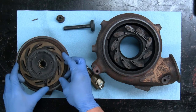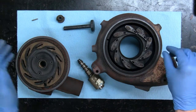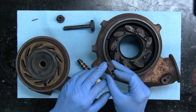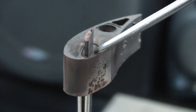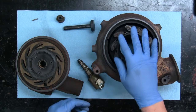Also, different types of binding can cause wear in different areas, and obviously with age you can develop this as well. But the tabs on the vanes themselves can wear quite badly, and these are not available separately — and this is an issue we see with rebuilds where these get reused.